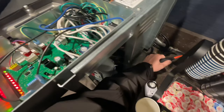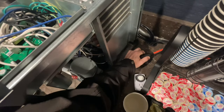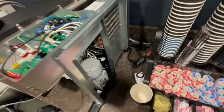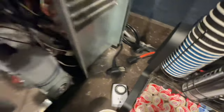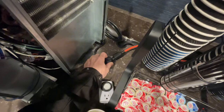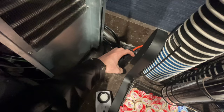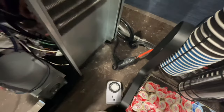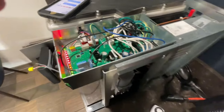I then tried another reset by just unplugging the unit and plugging it back in. The cord was giving me a hard time and I ended up needing two hands to unplug it. I also checked for voltage to make sure we were getting 120 volts. Worth noting — you're not really supposed to plug ice machines into an extension cord, but that's what they were doing. Unplugging and replugging didn't change anything.